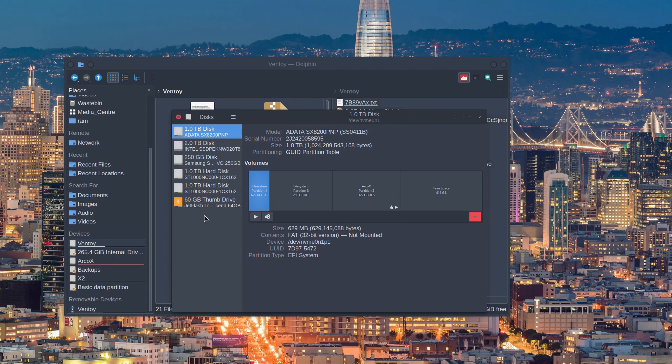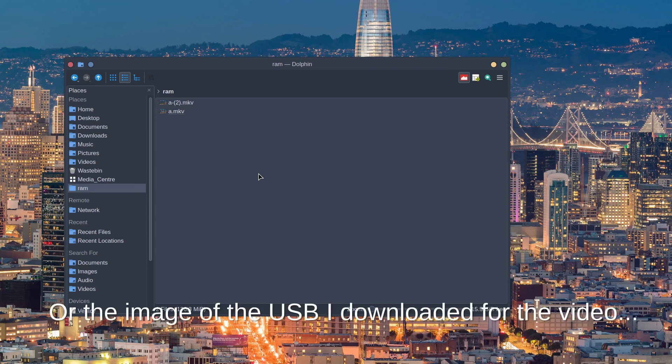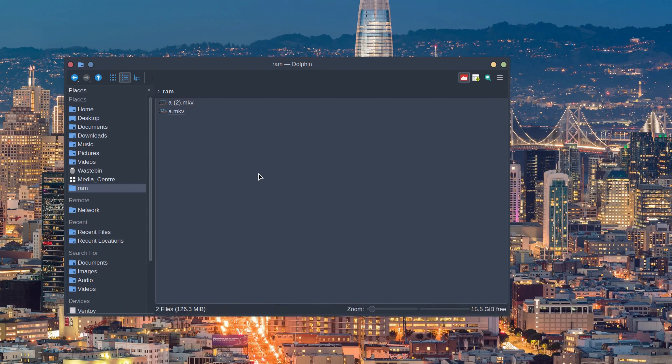I'm going to quickly show you a recording from the cell phone of me booting up from the hard drive. But before I reboot, someone asked me why I use a RAM drive on my machine. I use RAM drives because sometimes I want to download a song, a video, or an ISO and I don't particularly want to save it permanently — just keep it in a temporary state. RAM drives are excellent for not wearing out my SSDs or hard drives. And there's no fragmentation on my file systems. It's stuff I don't intend to keep, at least not yet. That's where a RAM drive is absolutely awesome, especially when you've got a lot of RAM.